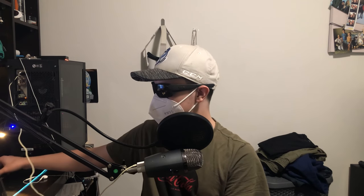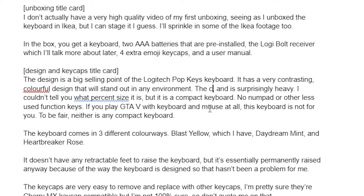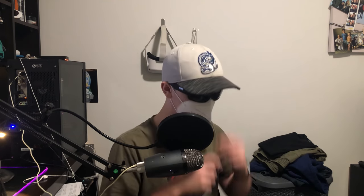So if you have an existing Logitech device like the MX Master, unless it is the Logibolt edition, it won't work. Unfortunately, the system isn't flawless. I'm sure the security is fantastic, but I've been having a problem recently where my keyboard suddenly disconnects and continues to repeat the last key I pressed. I even ran into the issue a couple of times while writing the script. I fixed it by moving the USB receiver closer to the keyboard, but then it started happening again — not as frequently, but it still happened.